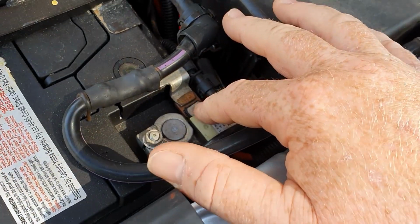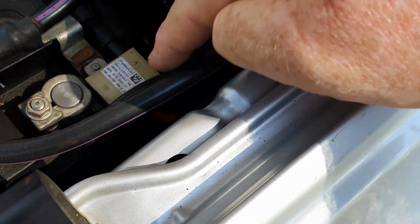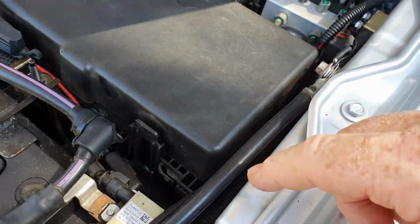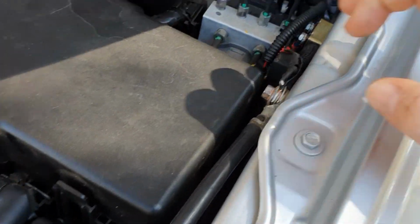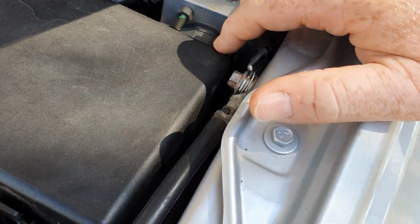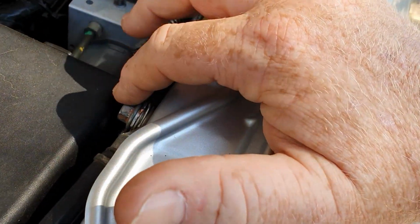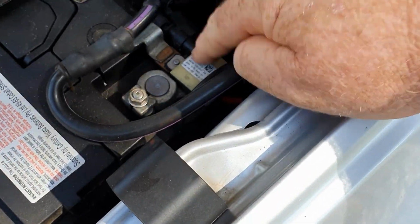So whenever you see this kind of stuff on the negative post, this box and all that sort of stuff, it means the car generally will have a smart charge, where the alternator can turn off and doesn't always deliver 14.4. So you must ensure that all your negatives at least go off here. You can add a fuse box if you want, run that to a negative or whatever. But I just run my positives all off the battery and then negatives all straight to the main earth stud here. There you can see it runs straight to the negative post of the battery.